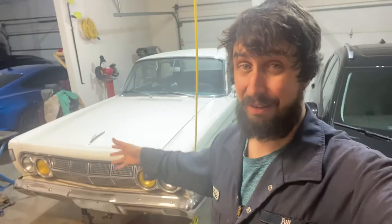Everything is basically done now on the car — we've got the springs off. Don't return your spring compressor once you've removed the springs unless you're putting on significantly shorter springs, and even then sometimes you still need to compress them a little bit to get them back on. In the next video we'll remove the upper and lower control arms, disconnect the spindles, and probably remove the brakes. Then we'll start cleaning everything up — get all the major crud off the parts, dip everything in a degreaser, let it soak for a couple of days, degrease everything because we want to paint everything and make it look nice before we put it all back on the Comet. More on that in the next video.